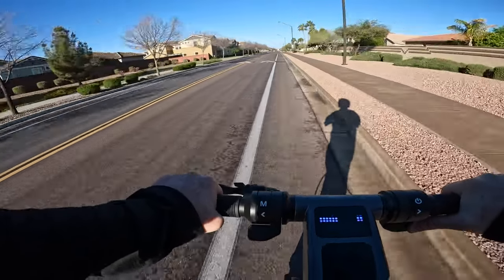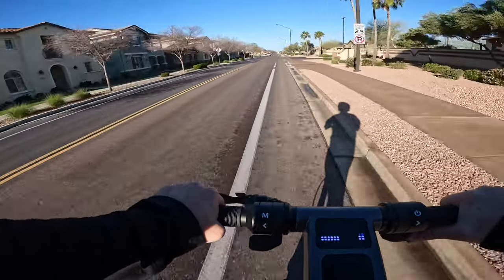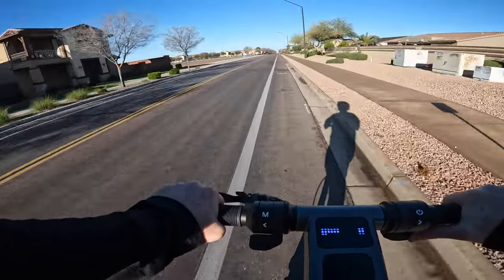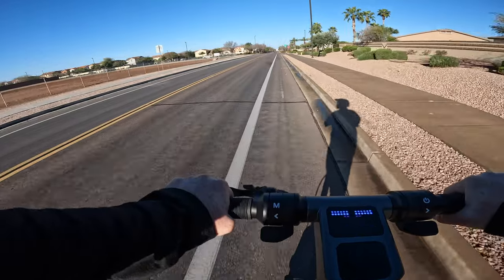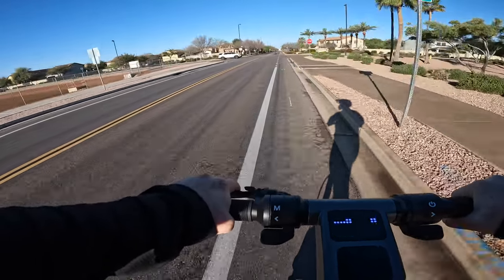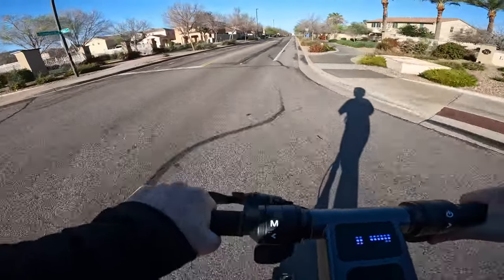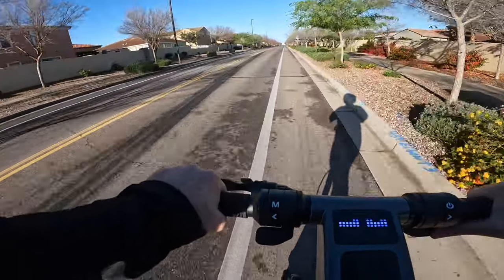One thing I want to mention: going through the Apollo manual last night, they specifically say that when you have 100% charge, they do not recommend using the regenerative brake throttle until you get to about 90% battery because there's a risk of overcharging the battery. That's definitely something to take into consideration. I think in the future they should probably prevent usage of that lever until you hit the 90% mark in software, since not everyone reads all the manual pages.